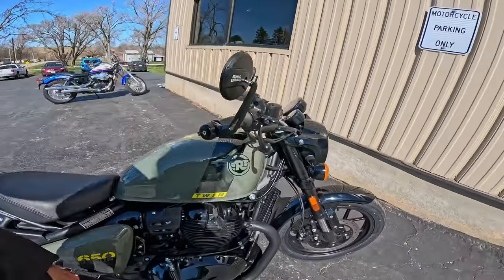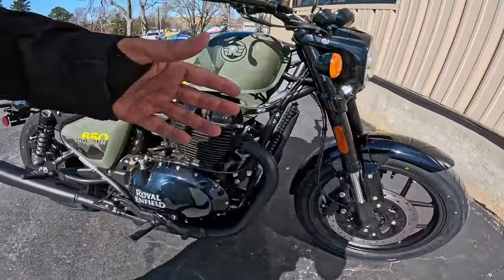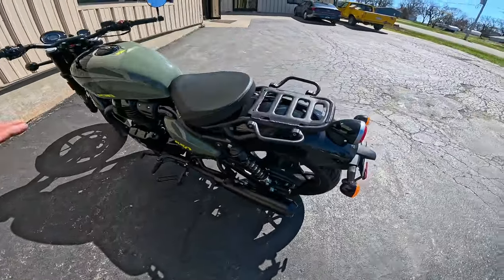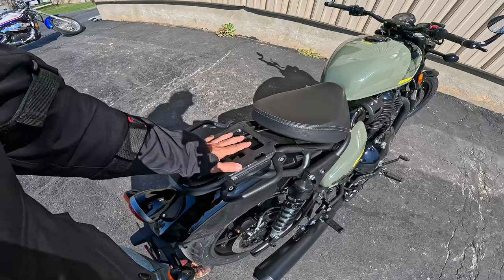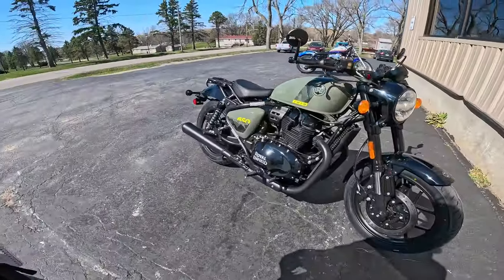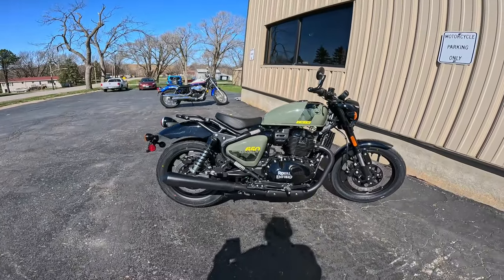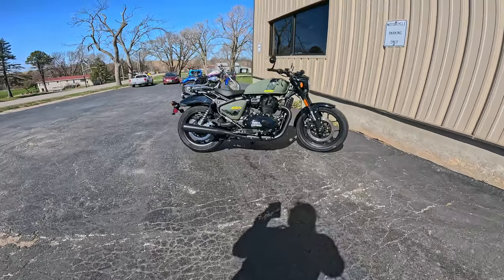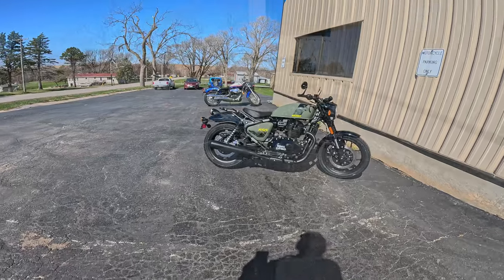Compared to the Super Meteor it has a different back fender — shorter — and a different sculpt to the side covers. It's got a different shaped tank, different handlebars, just all the little things are different. I love the way they did this — check that out. The add-ons include the pipes, the skid guard, bar and mirrors, and they also added a DNA filter to it. Really nifty. It does have a back seat — they just took it off. Seat height in stock form is 31.3 inches, that's 795 millimeters. Wheelbase is 57.7 inches — 1,465 millimeters. Fuel tank is 3.6 gallons, 13.8 liters. Wet weight is 530 pounds, 240 kilograms.